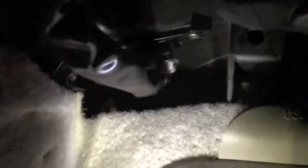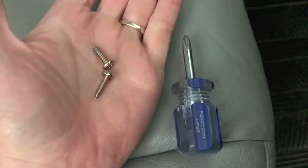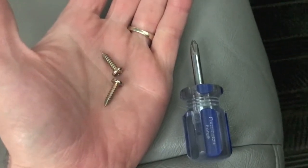In our case it is located on the left side — secured by one Phillips screw on the right side and an additional Phillips screw on the left side. You can also see the electrical wiring. First thing we want to do is remove the electrical connection point from the resistor. There's a little tab — push that tab forward while simultaneously shifting the connection point down. Once the wiring is out of the way, remove those two Phillips screws and lower the entire resistor out of the slot.